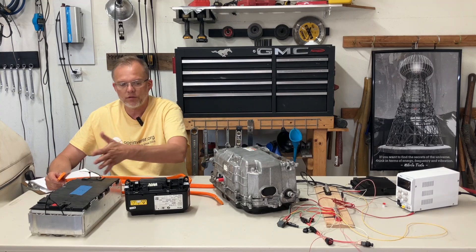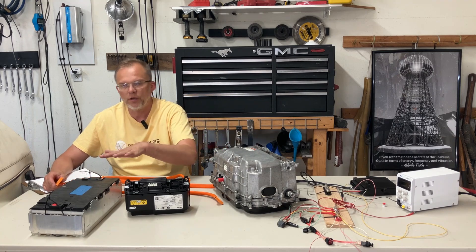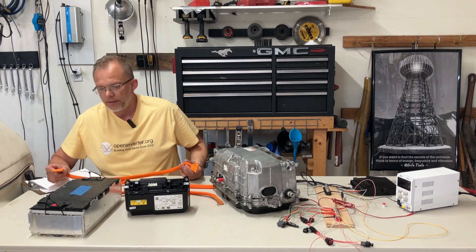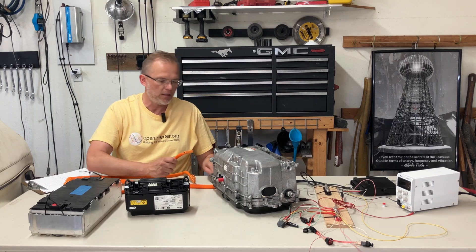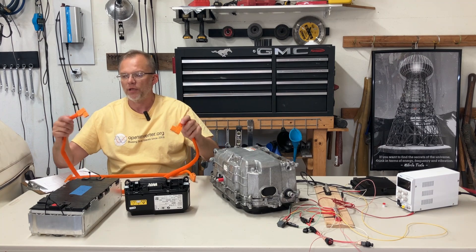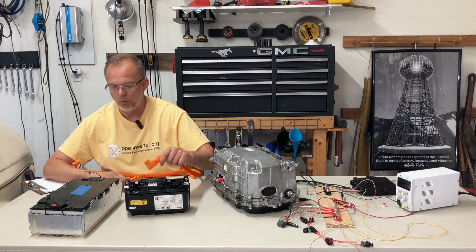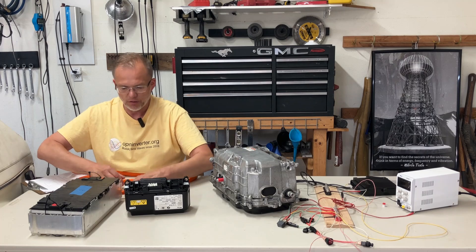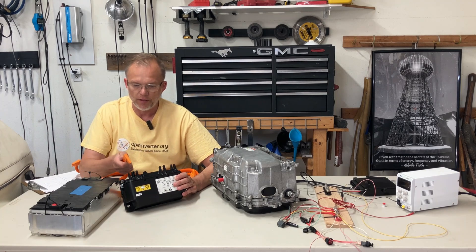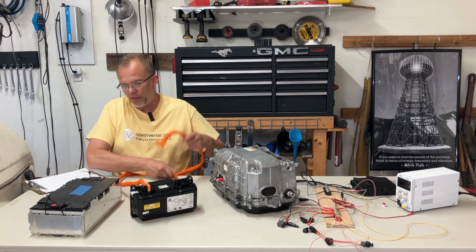Normally what you would do is connect the battery pack last. This is only 60 volts, but I'm still being careful. So what we're going to do is take this — an actual lead from a 530E. It's a very long lead labeled S-minus, or S-negative, which is safety box negative, and then one-minus, which is the battery negative. I'm going to connect the negative here to the battery pack for the input, and then connect the other end to the battery module.